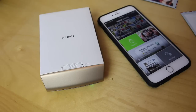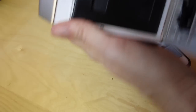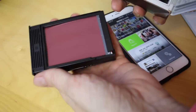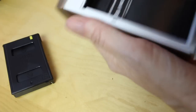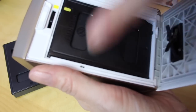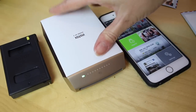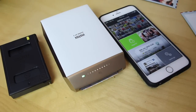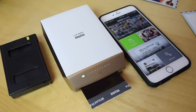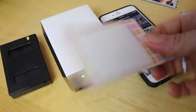The film cartridges are quite easy to change. You basically just pop open the back of the Fujifilm Instax printer, pop out the old cartridge, and put in a new one. It's worth mentioning that you can't switch cartridges before all of the photos have been printed. If you do, you're basically going to ruin two sets of film, because those cartridges aren't fully sealed, so light is going to bleed in and ruin most of the film left inside.